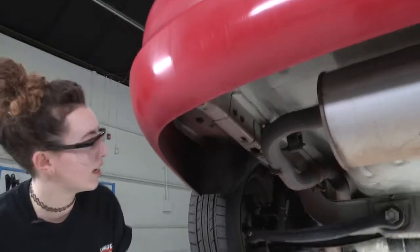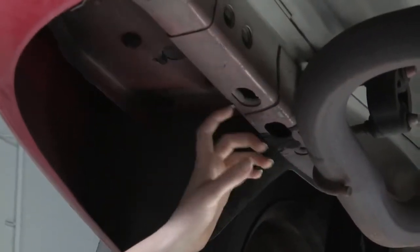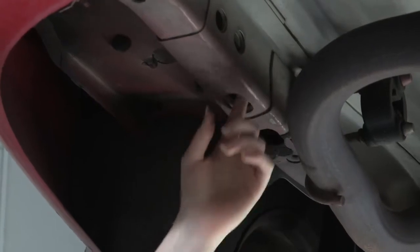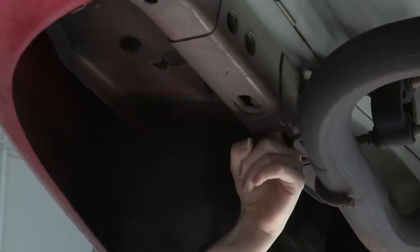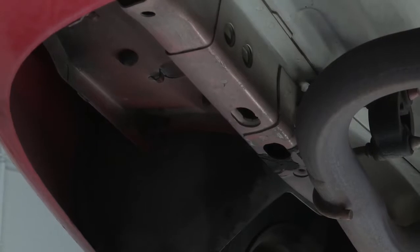The first step — we're going to take a look under here on the driver's side. This is our hardware hole where the bolt is going to come down through, but we're going to access it through the access hole here and use a fish wire to get our hardware all the way through down to that hole, and then we're going to repeat that on the passenger side.